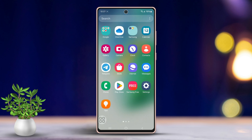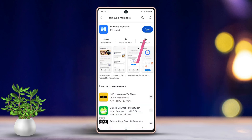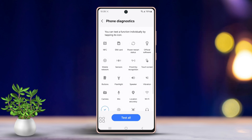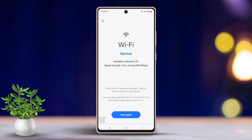Solution 1: Check for hardware issues. First, ensure you have the Samsung Members app installed from the Play Store. Launch the app and tap on Diagnostics. Sign in with your Samsung ID — if you don't have one, take a moment to create one. Once signed in, tap Phone Diagnostics, scroll up, and select Wi-Fi. When prompted, tap 'While using the app.'